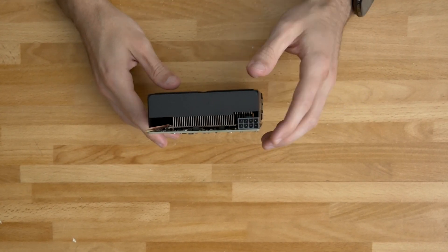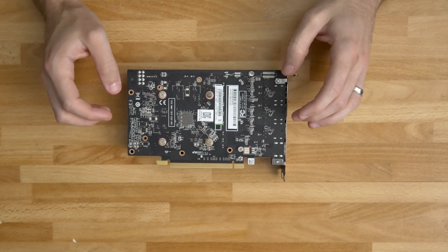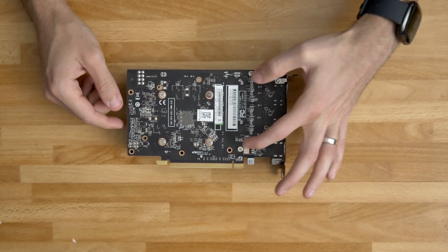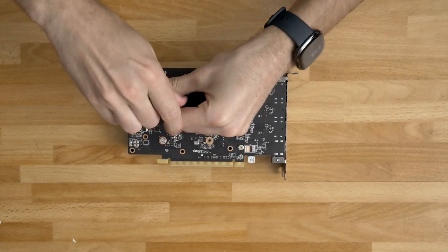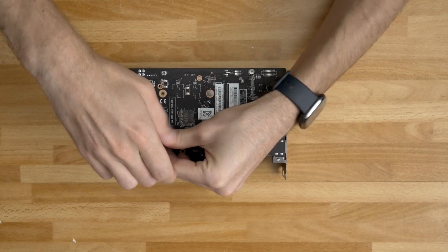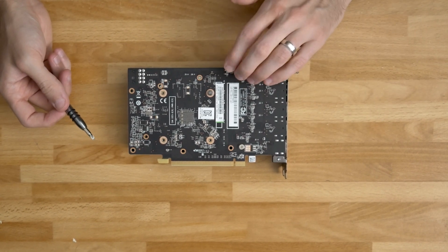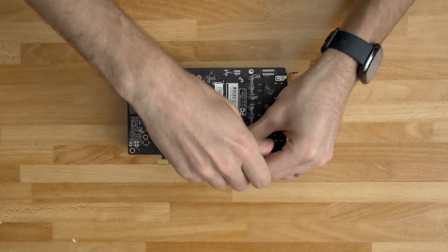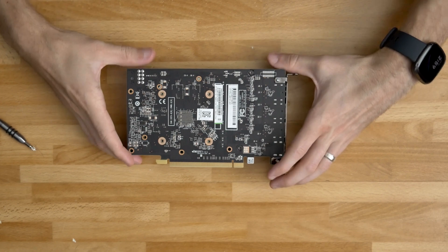On the back side we have a single eight-pin PCIe power connector. Flipping it over, I think it's going to be pretty simple to get into this card — we obviously have to pull off these four screws around the GPU core, and then maybe just two more and we might have the cooler off. It's also interesting that there's no warranty void sticker on this card, so HP — where this card specifically comes from — would be none the wiser if you tore it down. Though technically in the United States you're allowed to tear down your products without voiding your warranty, you'd have to be prepared to fight that in court since HP does have resources.